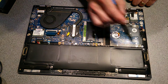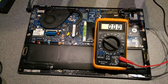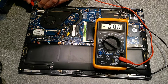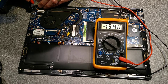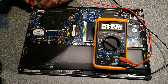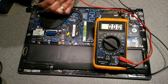Those are the speakers on either side. The issue I was trying to troubleshoot was the machine was totally dead — you press the power button and absolutely nothing happens. Initially it's checking whether there's voltage going across onto the motherboard, which there is. That leads you to the worrying point of maybe the motherboard has failed, or a component on the motherboard has failed, or possibly even — given that the CPU is missing screws — that could have caused damage or something similar.